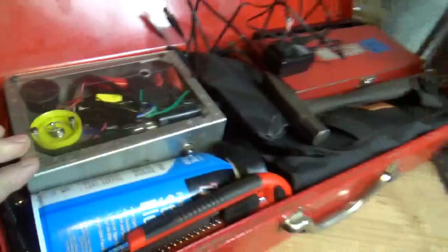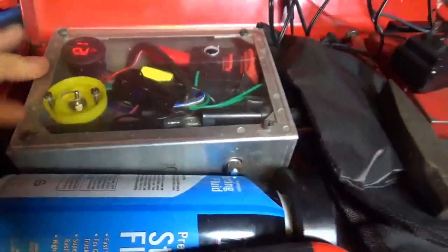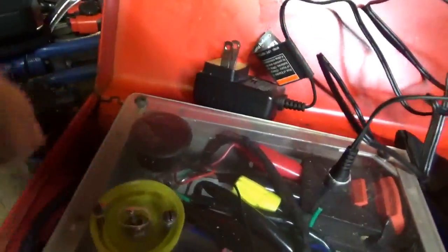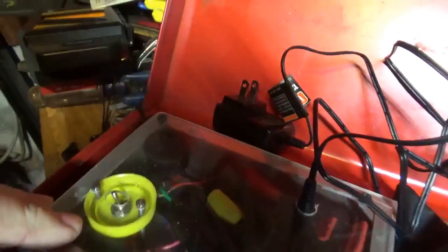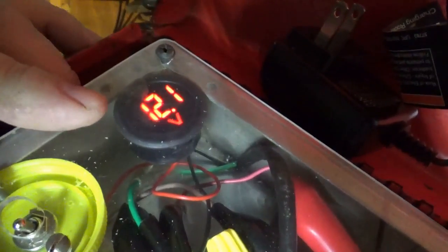Here is the portable CDI box — you can see I stuffed it in my toolbox with everything else. You turn it on: 12.1 volts. You know it's charged. Should you need to charge it, plug that right in and there's a little light that comes on. When the light turns green, it's fully charged. The nice thing is as you're using it, if anything is strange, you can keep an eye on it. If you watch the voltage slip below 12, you can say, hey, maybe I should recharge this thing.